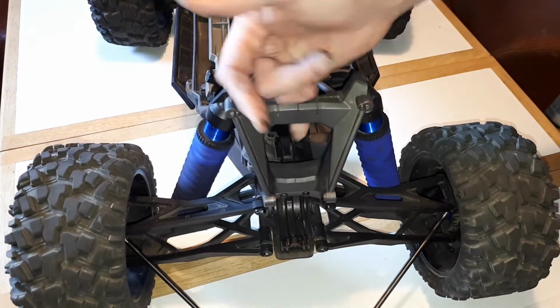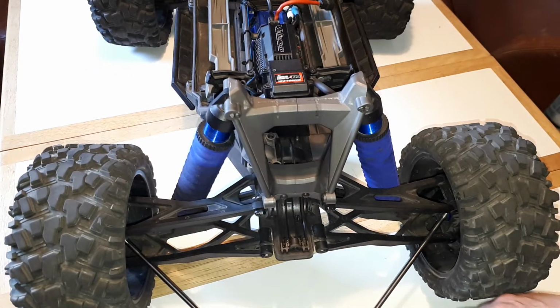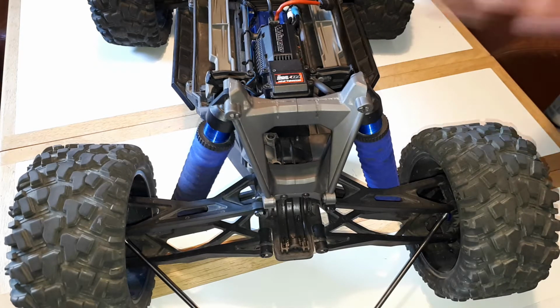Make sure you got all the metal out, and off from around the differential cover. Because the last thing you want is bits of metal left in there, then when you put the new one in, you break it again.